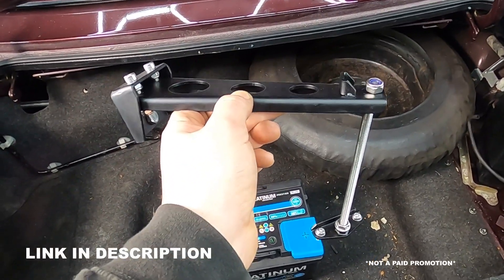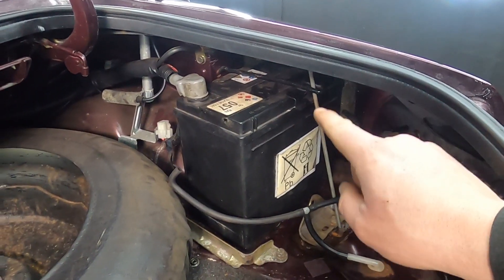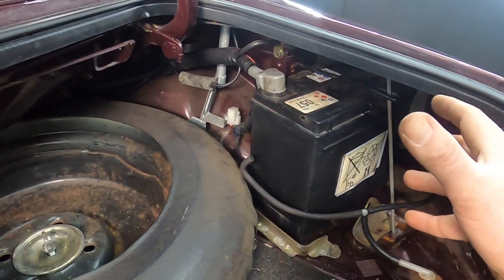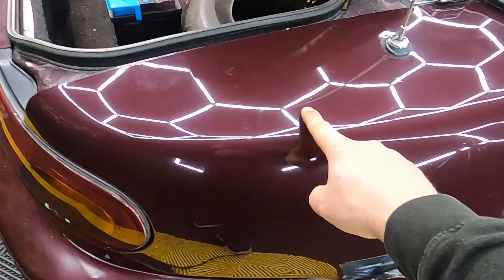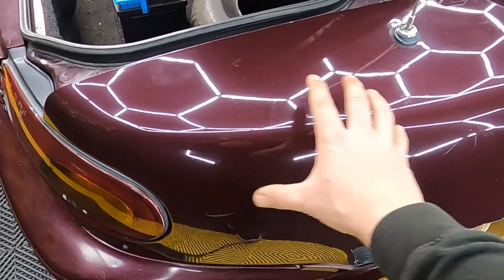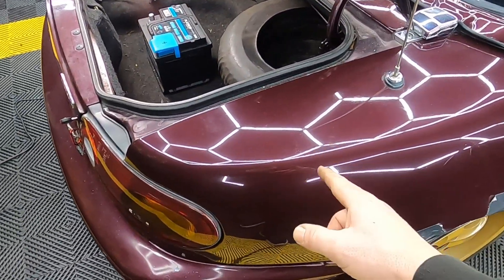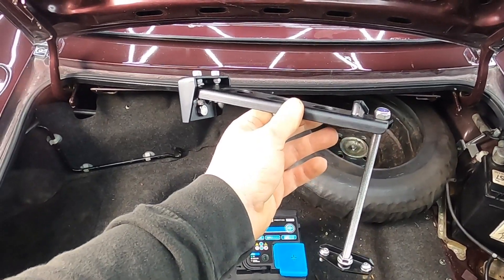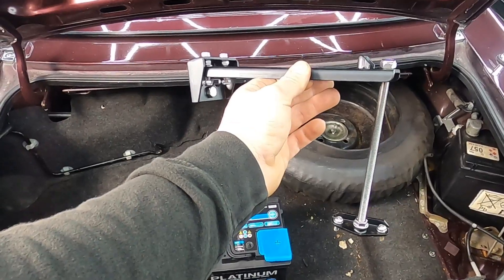This simple 063 tie-down kit is going to save you a lot of money and stop another common problem — the original battery tie-down likes to snap, and then the battery wiggles around in the boot. Going over bumps, the battery goes up and down, and this rear arch commonly dents from the inside out, completely ruining your paintwork. This tie-down kit is really strong and secure and will eliminate all of those problems.